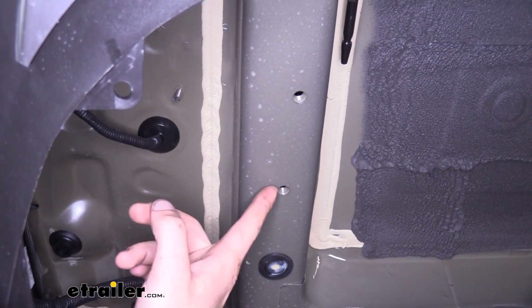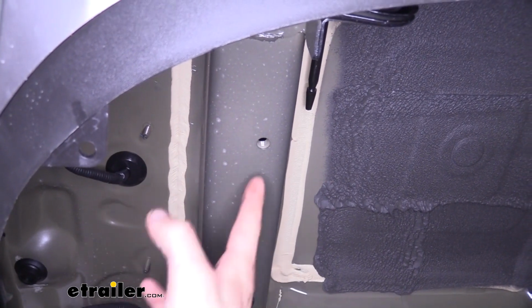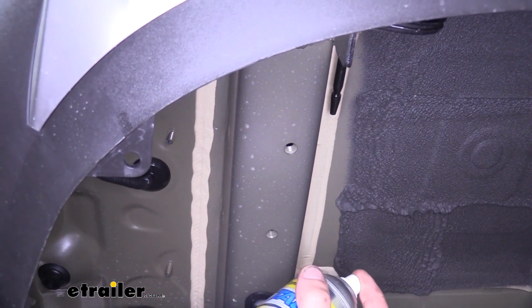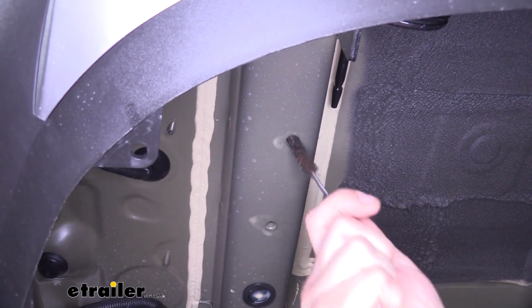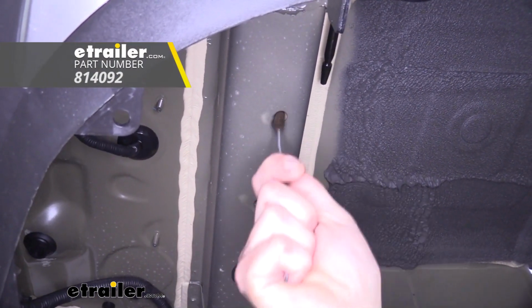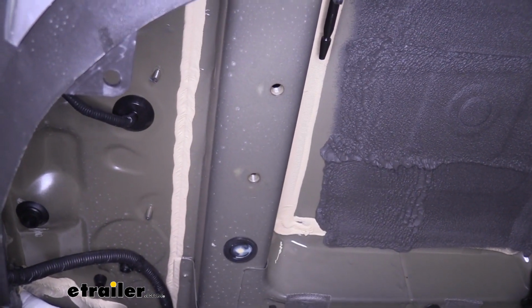The weld nut's located in the bottom of the frame at the back. Some of our hardware will install in the weld nuts located in the frame at the back. To make it easier to get your hardware installed, I recommend spraying some spray lubricant in there, and then using a bristled brush to clean out any dirt and debris that may cause your bolts to hang up. Do this to the weld nuts on the other side of the frame as well.